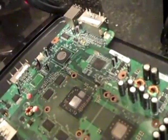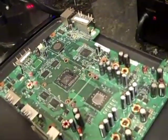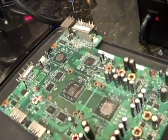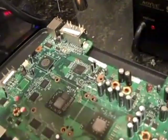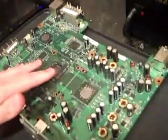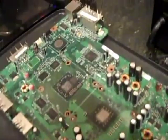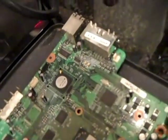Hey guys, it's Inedible from the Modification Nation, and I'm going to show you how to fix your Southbridge chipset on your Xbox. It is one of the main causes of the Red Ring of Death, but it receives infinitely less credit than it should for causing this error. So if you have no idea what's causing it and you've tried everything else, this is an option on how to fix it. I'm going to show you both how to reflow and how to re-ball it. I'm making a video on how to re-ball the GPU as well, but I'm starting with this one because I feel there's a gap in the Xbox 360 fixing world on YouTube, and I want to fill that gap.